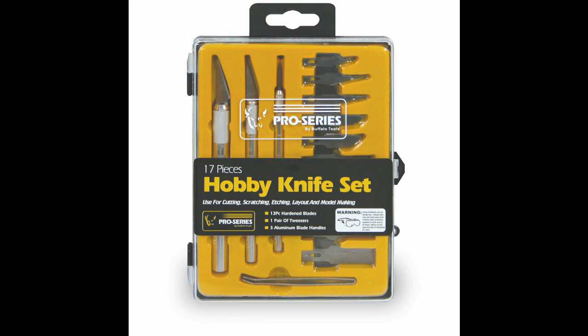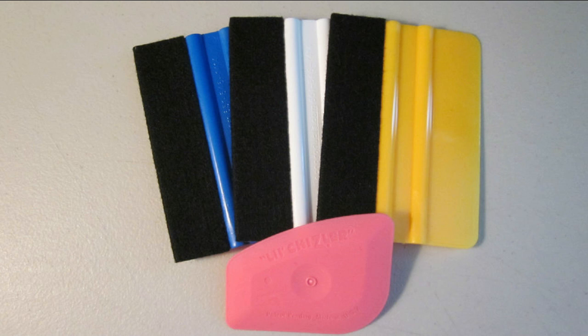If you're still watching and want to give vinyl wrapping a shot for yourself, I'll give a quick summary to reiterate what I learned by watching a whole bunch of installation videos. Spend some time planning. You need to understand how much vinyl you're going to need to do the scheme you want, and if you plan on layering or making seams. Have a sharp knife or knives for cutting the vinyl. This is really important. Get a good heat gun. A good soft squeegee will help with the install.